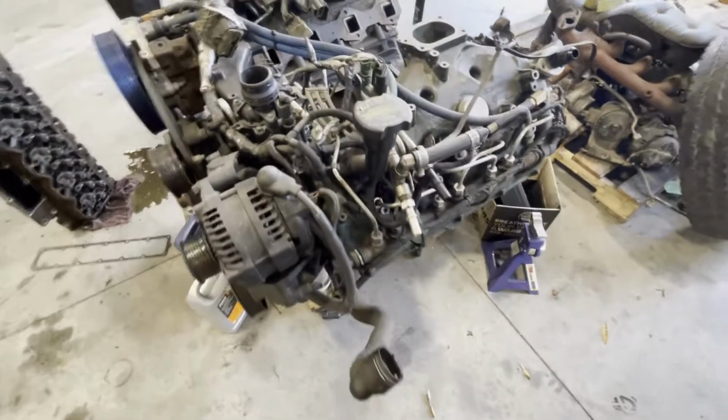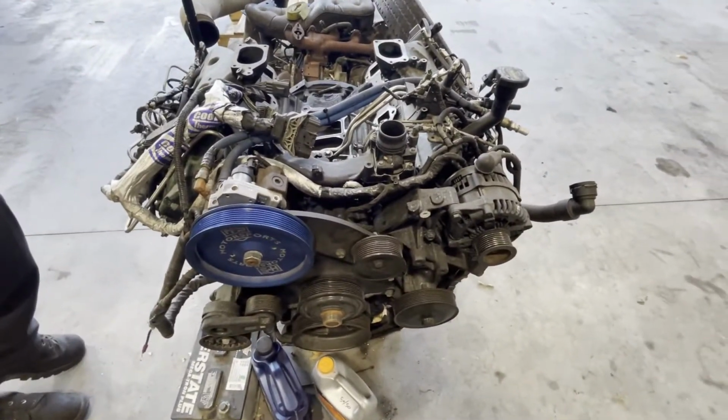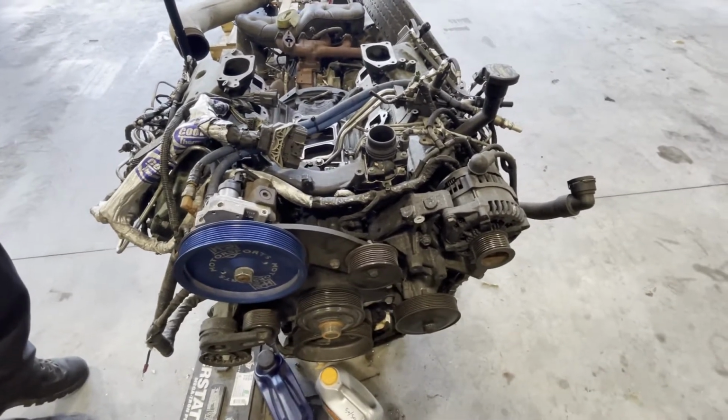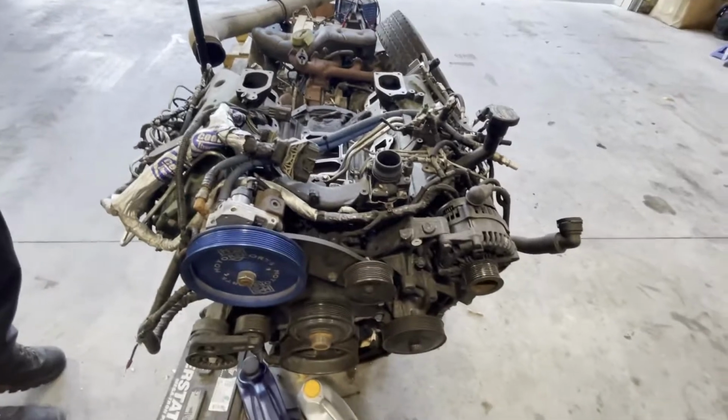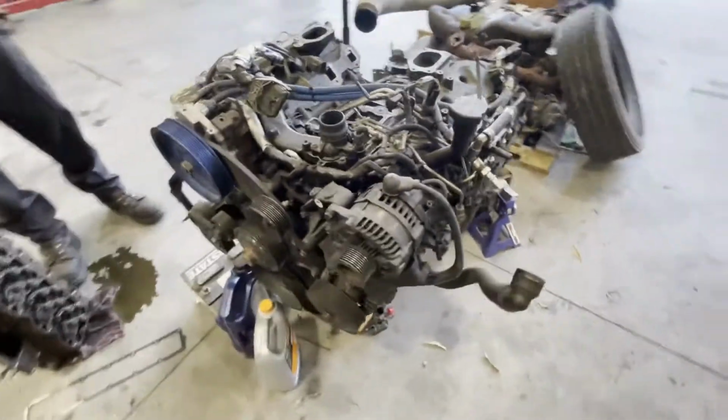We put fiberglass bedsides on it. It had a 6.7 Power Stroke motor in it with Carrillo rods, dual fueler, hundreds, an S476 with a GT55 over it, compound. We ended up popping this bottom end actually. It still had the 6R behind it.